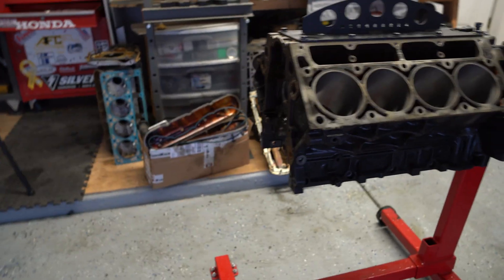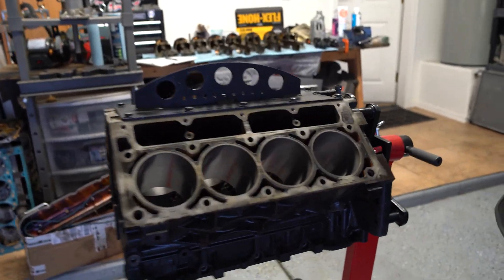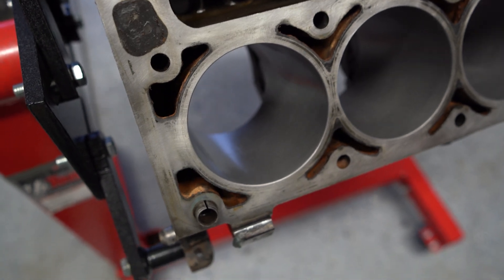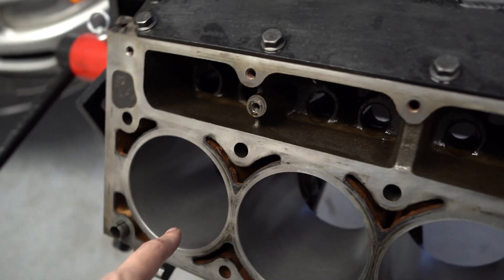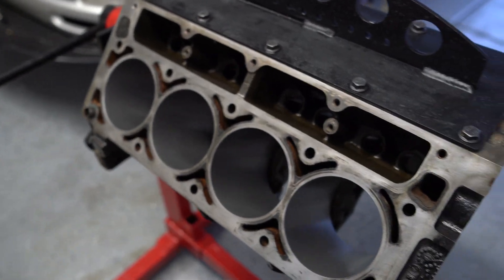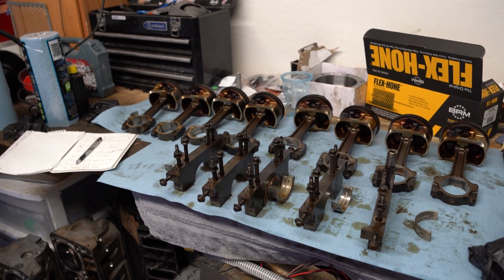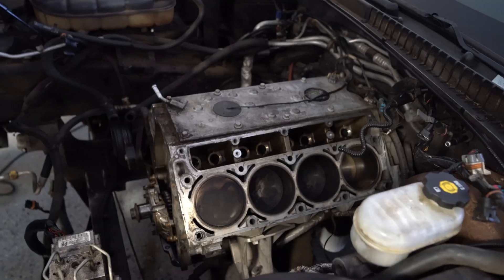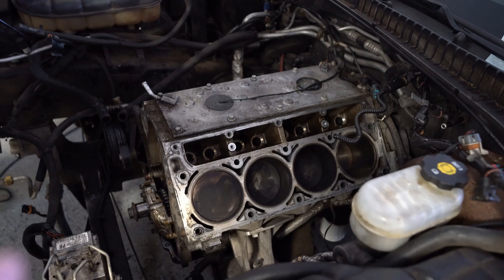I think that's going to do it for today's episode. As you guys can see, the block looks really good — the bores are nice and cleaned up. I think I'm just going to have this sent to the machine shop anyway just to double check everything over. Still didn't really get that one spot totally cleared up, so I might have the machine shop do a more extensive bore to clean up that one spot. But overall the Flexhone did a really good job. If you guys have any recommendations on my bearing situation — the fact that these are fairly new bearings and they're all worn out, possibly something to do with the crank — let me know. Any suggestions are good. And in the next episode I'm also going to be taking this block out and disassembling it to see what's salvageable.